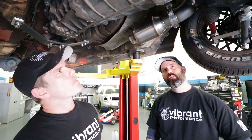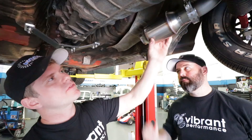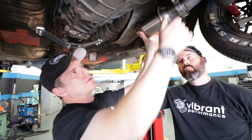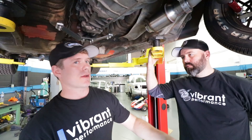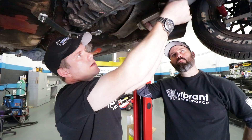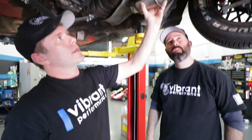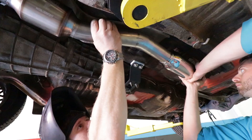A lot of times when exhausts are being connected you see them using just a flange with three bolts and a gasket. What's the advantage of going to the V-band setup? Well, with the V-band you've got ease of fabrication and quick disassembly. If you have to service the vehicle quickly — say you're at the track — taking a V-band connection off is a quick release. It's one bolt that just needs to be loosened a little bit, and then it's got a quick release latch on it with a self-centering ring. Putting it on again is just as easy.